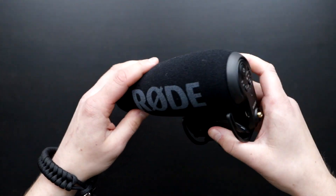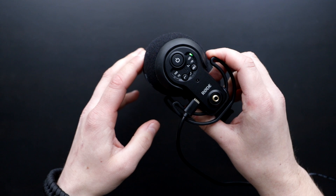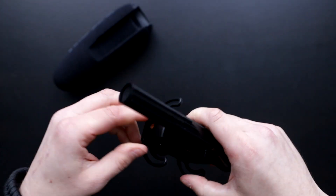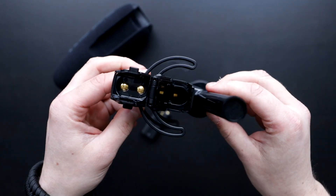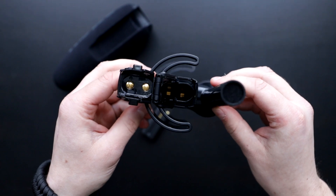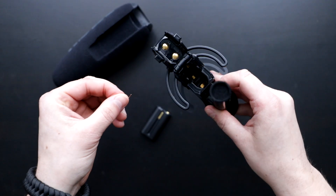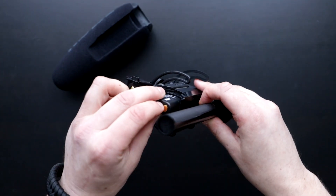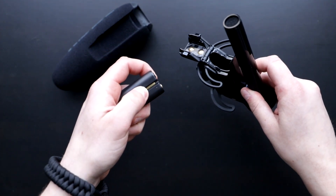Out of the box this thing has one major design flaw. When you go to plug it in, if it was actually recognizing the rechargeable battery it should be flashing a blue LED light, not a green one. So if we open it up and take a look inside, we'll see what's actually going on. At the back of the battery compartment there's a copper wire that should be resting along this edge right here. What's actually happening is that copper wire is just hanging out in the back, so when you push in the battery it just bends that copper wire. The battery copper is not making contact with the copper wire, so it's not actually charging.